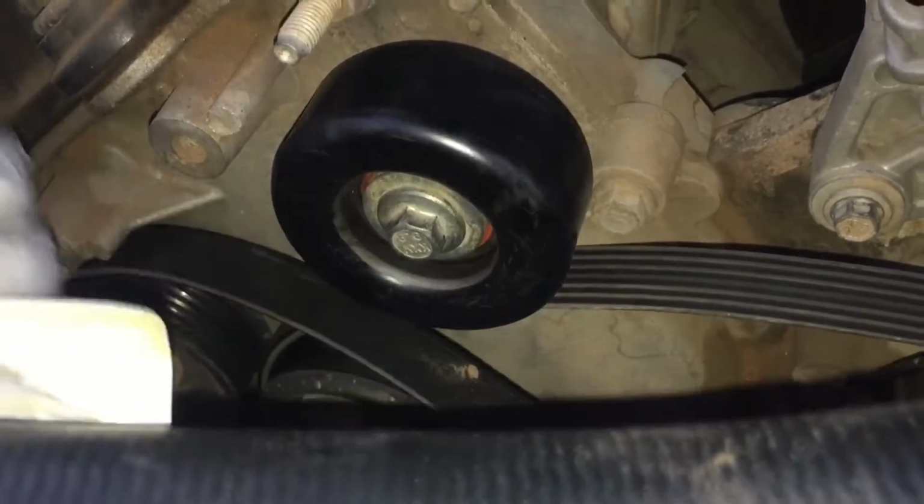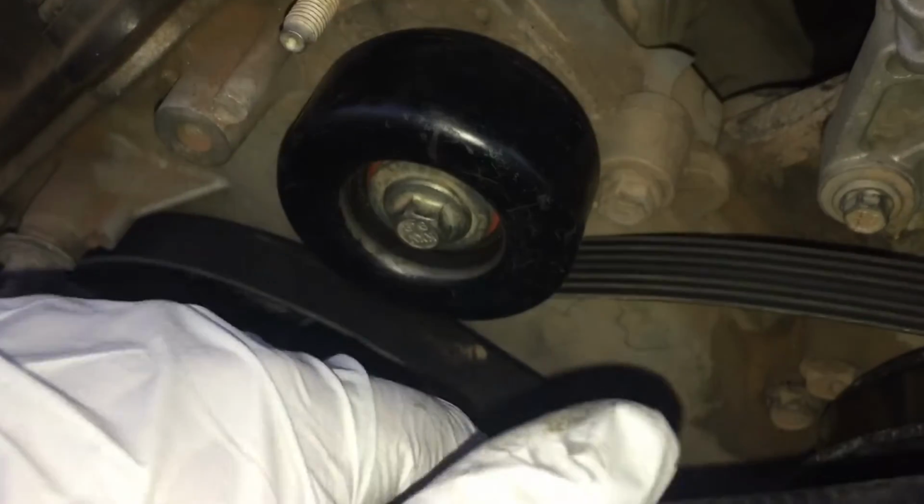It's not a lot of pressure, and if you do it too tight, it could ruin the bearing that it's tightening against. Okay, see, that's a better spinning one there. See how it stops on its own too, a lot quicker? There has to be a little bit of resistance on there, and that's how it's a good bearing. Hear that? Bearings are just dry in there.